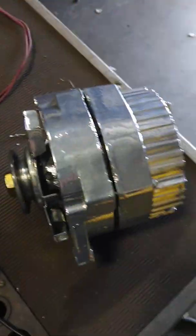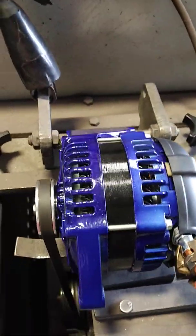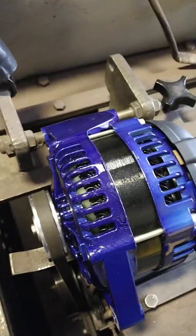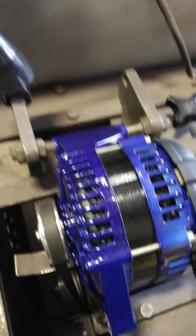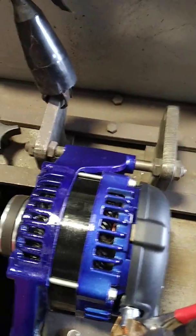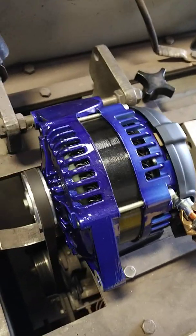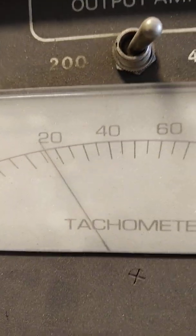The difference between these two is drastically different. So if you've got those old-school Fords, Lincolns, or Chevys and you're having issues where your batteries are getting drained when you go out on cruise nights — thinking your alternator was supposed to perform — just look at the idle output specifications, not the max output ratings. When you're going out on cruise nights, you want that idle output so your batteries aren't dead when you get home after a fun night of cruising. Drop any questions or comments in the comment section below. Thank you.